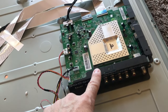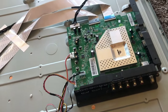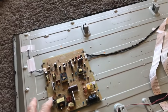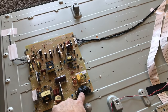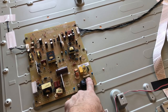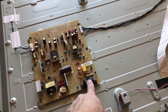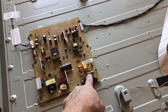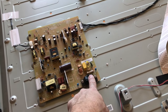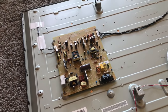If you got picture problems — HDMI ports not working, coax, or if you're just getting a fuzzy picture — I would replace this board first; this is going to be your problem. If you have no power going to your unit, it's usually this board right here because that's where your power goes into. Also look for things like a little fuse there — you can use a power tester to test them. The quickest way to find out if your fuse isn't working: put a tiny thin piece of aluminum foil from here to here while it's unplugged, then power the TV back on. If it turns on, remove the aluminum foil and go get a fuse if you don't have a power tester. That could pretty much fix your problem right there.